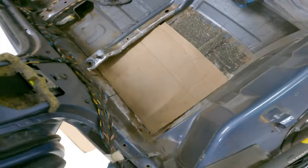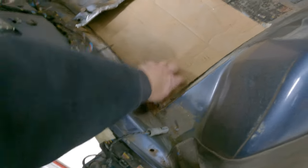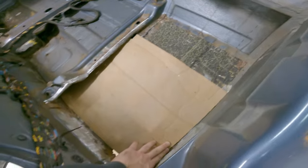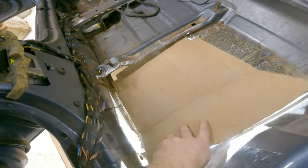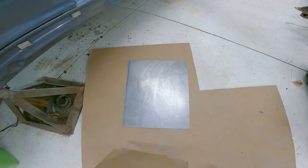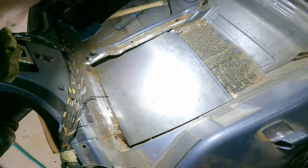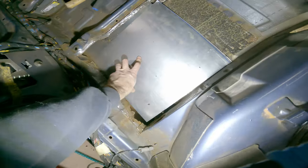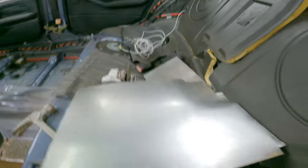The template is basically done — it's rough, it's cardboard, but I have the general shape and dimensions of everything. I'm going to trace it out on the metal now and start cutting. Super simple — just cut it out, take it to the car, drop it in, and see if it fits. After a little finagling we got it in there. I know it still doesn't look like much because it's just a flat piece of metal, but that's pretty much all it's going to be. I might do a couple of bead rolls just to give it a little bit of strength.